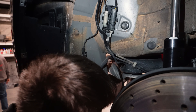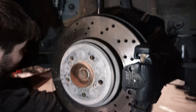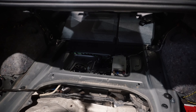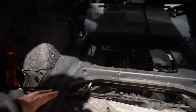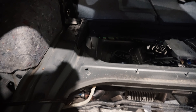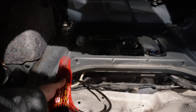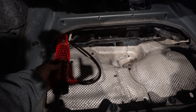For now we're just going to do Turner adjustable toe so we can dial in toe. Camber's pretty good out of the box from these so we'll be able to get to the spec we want, but toe is really nice to have perfectly dialed in for rear grip and tire wear. It's more important than camber when it comes to OEM adjustability.